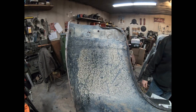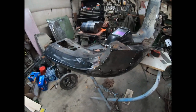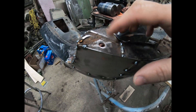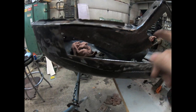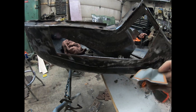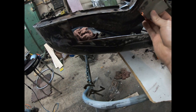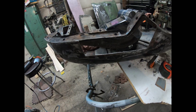We'll show you how that's done. So we've tack welded in the front portion - it's not fully welded in yet. Got this piece tacked and this piece - there was a crack here we had to address. Next piece we're gonna tackle is this inner brace here, it was rotten. I had a scrap piece of metal that already had a bead in it, and this one has a little bead in it so I decided just to use that.